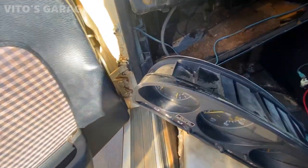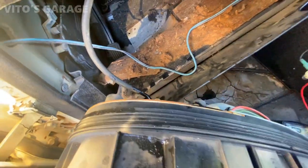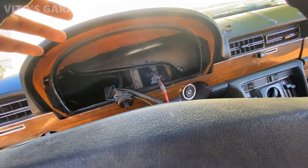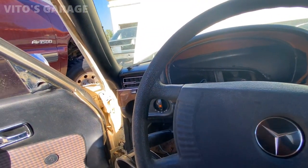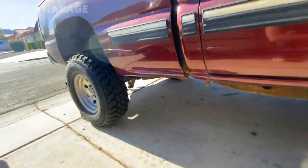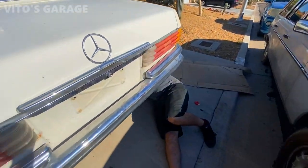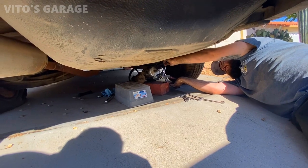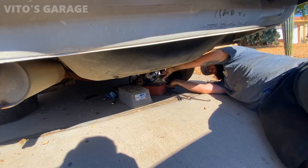And what's really cool about this thing is it actually has the oil pressure line right there, and I just undid it right now. So that's where there's some oil, but we should be able to fire this thing up. And we tried to crank it and jump the fuel pump, and there was some fuel spraying out of the pump. So Spencer is trying to add some Teflon tape to that nut, the fitting, and tighten it more. So hopefully that does something.